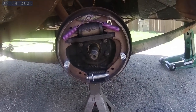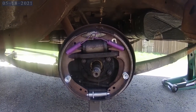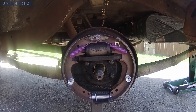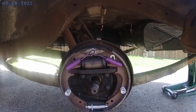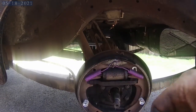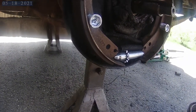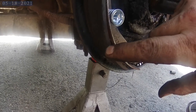I thought I'd show the brake setup at the end of the video. This is how the rear brakes are set up. I have new hardware on here - my brake was frozen up. I had my shoes re-padded at a local place that repads them. There was serious wear in the drum, it wasn't great, but I thought I could get away with just getting new shoes. But if you look - she's broke.